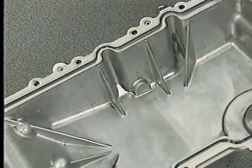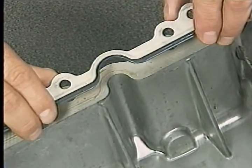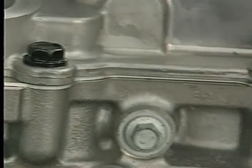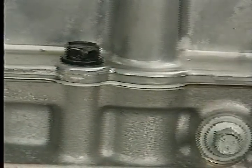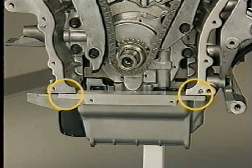The edge-molded rubber gaskets for the oil pan and other engine components have a metal backbone, which provides superior sealing by precisely controlling gasket compression. As a result, there is less of a gap between components and fasteners maintain their torque better. The new gaskets minimize the need for sealant at mating surfaces. On the 2.7 liter engine, you need to apply Mopar silicone rubber adhesive sealant at only two spots, where the oil pan gasket and timing cover gasket meet.